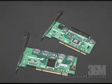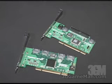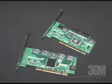There are a few different RAID levels: RAID 0, RAID 1, RAID 0 Plus 1, as well as JBOD. JBOD stands for Just a Bunch of Disks. For example, if you have two 100 GB drives, it's going to equal 200 GB in total. There's no security, no redundancy, no performance — it's just a bunch of disks.